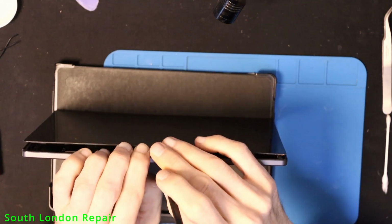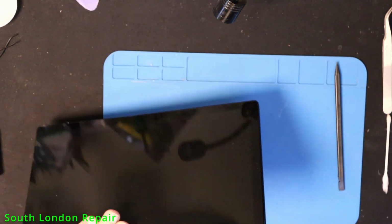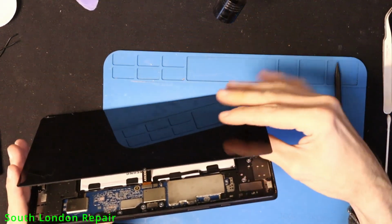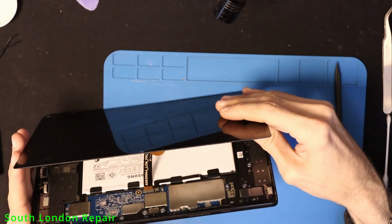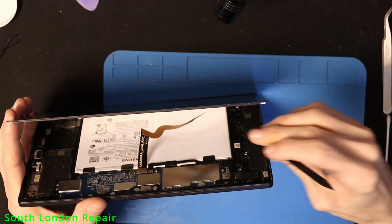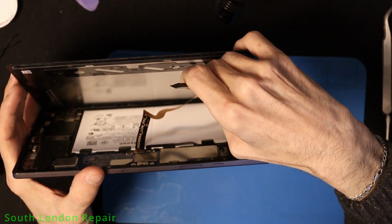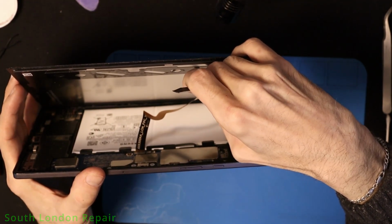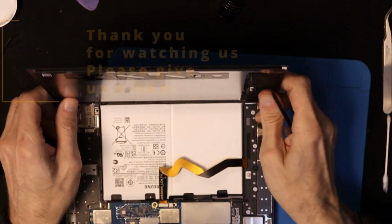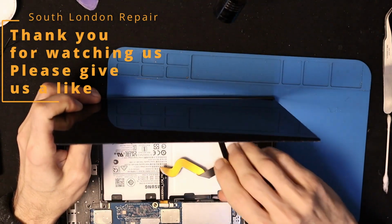Finally, I had enough and I made an order for a new screen. Once the new screen arrived, I hooked it up and yep, it started working. So if you're getting into the same situation when everything looks alright, but only the Galaxy Tab sign is coming up and nothing else, then just get a new screen and that's gonna sort out the issue.